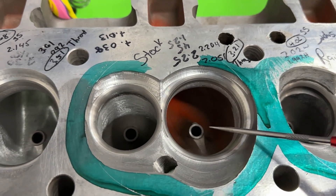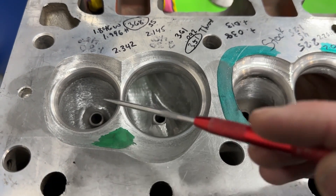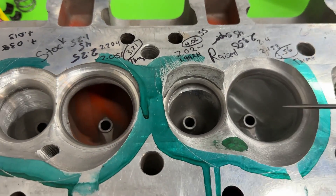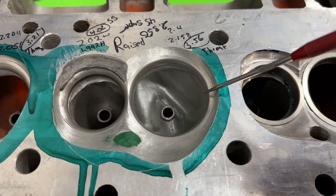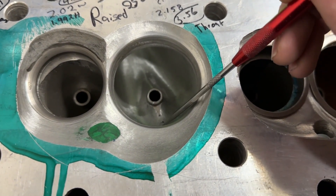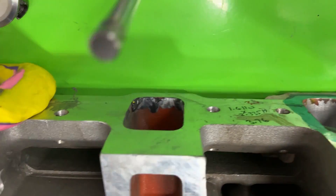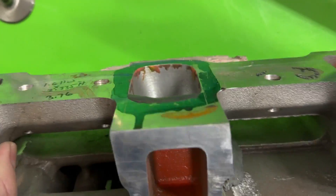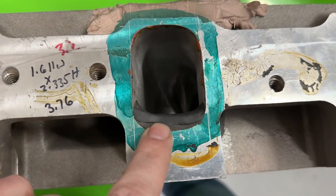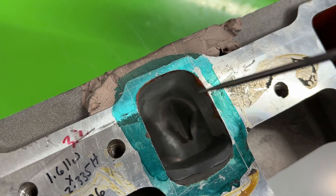I flowed a stock head after doing the valve job and then progressed. So this one's fully ported with a 2.300 intake valve, still the same 1.800 exhaust valve, compared to this one going out with the 2.25. This one got a lot of stuff done — it got raised, it's a 2.350 valve, much larger. Tried different vane locations: one here, then one further over. The port itself's raised up. I raised up the port thinking I'd keep going further and further, then filled in the floor as well.